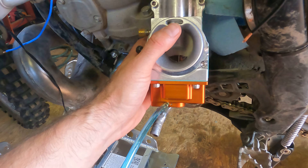The fuel mixture is easy to adjust. I've played around with it a bit to get it tuned just right for the kind of riding that I do. Fuel mileage is good and consistent. I noticed that I can ride anything from about 9,000–10,000 feet — which we did in Kennedy Meadows — down to 2,700 feet, all of that range without ever adjusting anything about the carb. It just works.